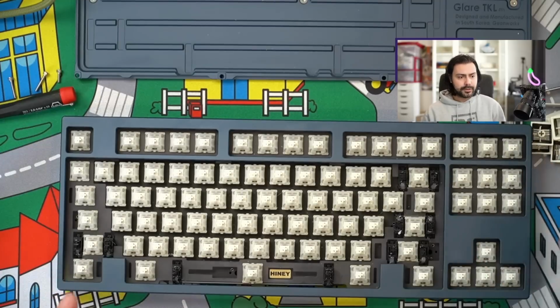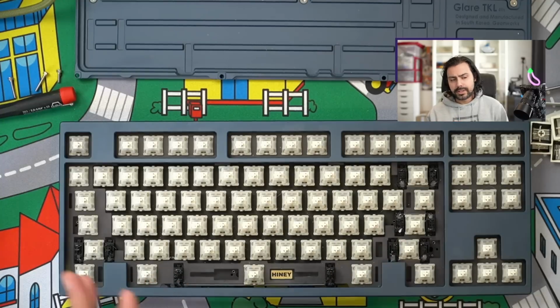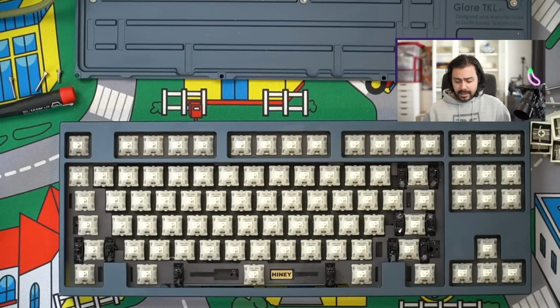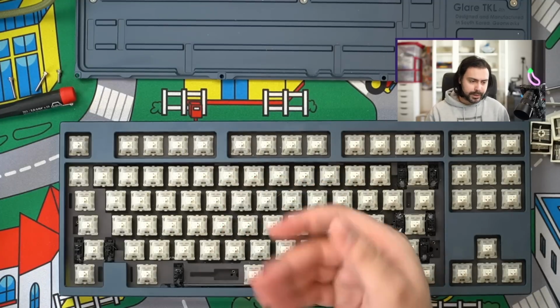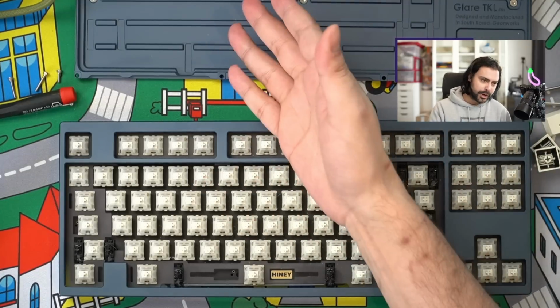All right. So last bit is, of course, my build recommendations. Now, I built it with Gat X round 2, relatively low weight linears, lubed with very thin grade 00 lube. Is good. However, the pitch is a little bit on the high side, because half plate, because super thin lube, because ABS caps, because no brass mid piece.